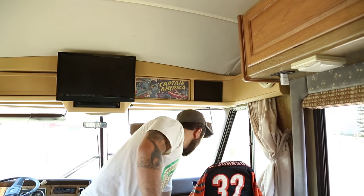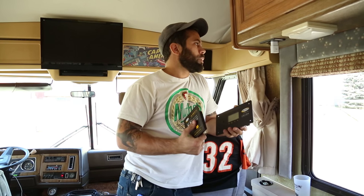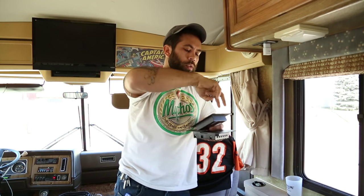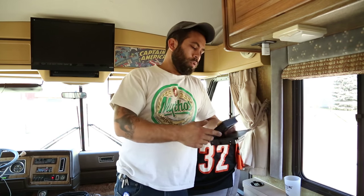From what I can tell, a lot of RVs, their batteries aren't all the way up in the front. So mine are all the way in the front. Ah, let's go in the RV and look. All right, we'll have to mount these two boxes. You go from the solar panel to these two here. But you need 2 inches behind it, and I don't want wires hanging on my wall. I was gonna go through the vanity, but my batteries are all the way in the front, vanity's all the way in the back. So I don't want my wires to come to this box, fine. But then I gotta run these all the way to the lead battery, which is down there. So that's pretty far, and then all the way back to the automatic transfer switch.